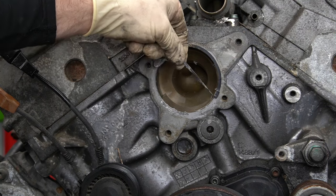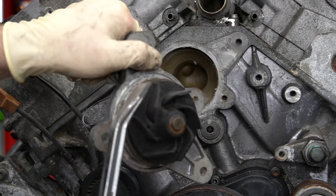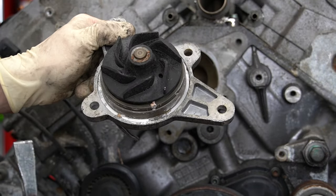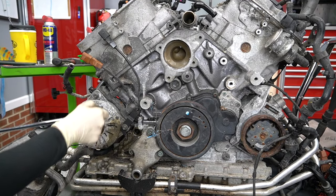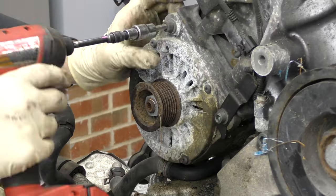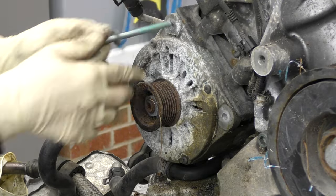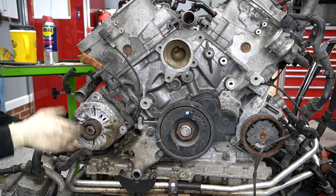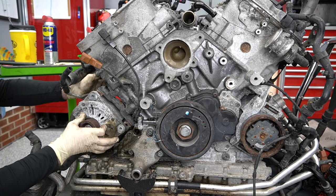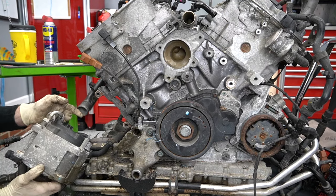Dry as a — look at this. There's our seal and our water pump. Looks pretty crusty in there, but all the fins are on there, so that's good. Next, let's get our alternator and our oil filter housing off and out of the way. This is actually a really cool alternator setup — it's liquid cooled, so it has coolant running through it. I think once we get the entire rest of the engine disassembled, maybe we'll take that apart to show exactly what's going on in there. Maybe we'll take both of them apart — we'll see how many years this video lasts before I commit to that.